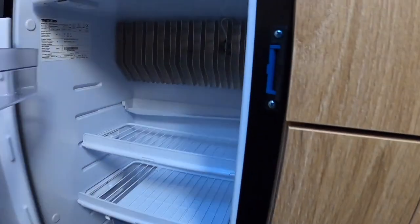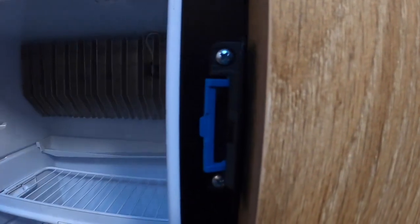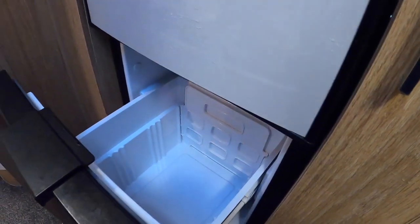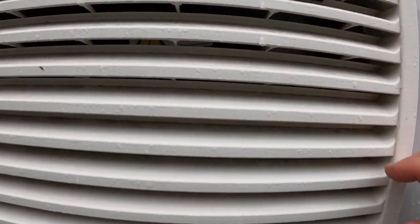The next one on the list is the fridge. Make sure the fridge is empty, give it a clean, and then the most important thing is to leave both the fridge door and the compartment drawer below it open — to allow the air to circulate around it. We also have frost protection covers, simple plastic covers that fit behind the fridge vent covers on the outside of the van.